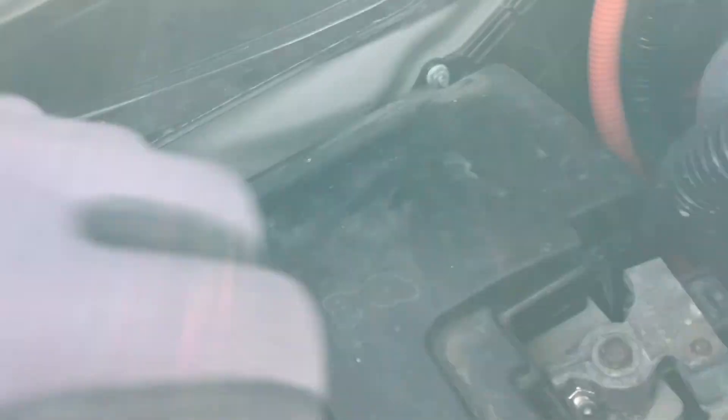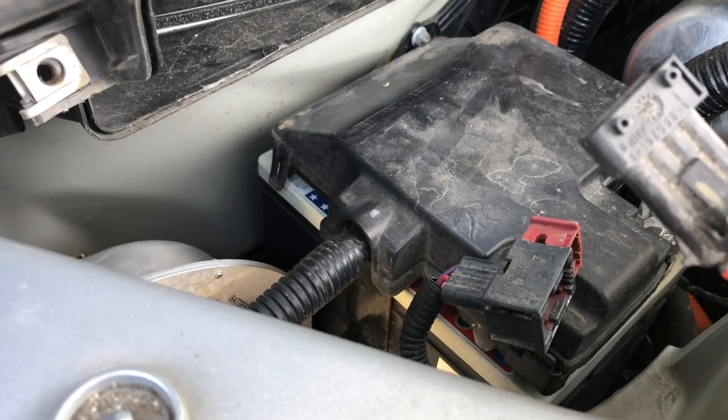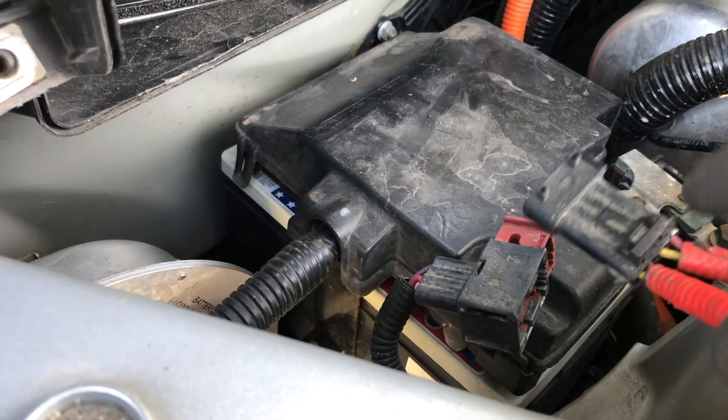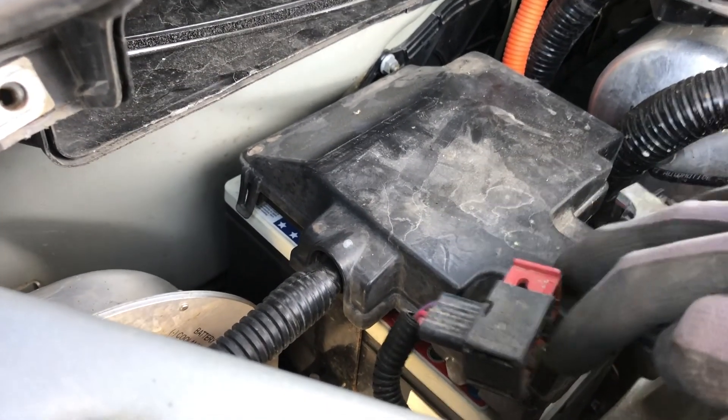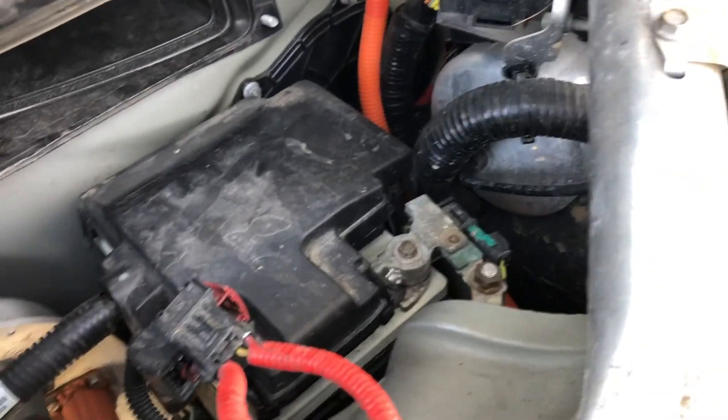Here's the fireman's loop. You're going to undo this clip right here by sticking a small screwdriver under this red plastic and prying up. Once you disconnect that, the high voltage system in the car should be shut down. But as always, to be safe, check any electronics you're going to work on to make sure they don't have any voltage going through them. I've gotten rid of the high voltage, but you'll still have the low voltage 12 volts going, so that's the next step.